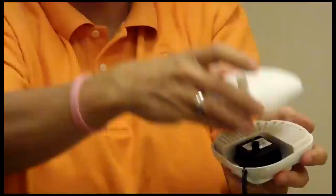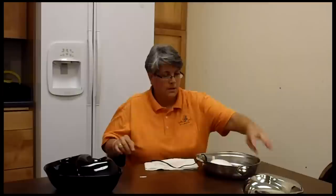We also need to put the filter in — filter goes in first. Then the pump housing cover goes on top. Once you have everything back into the pump housing, you can thread the cord through the slot. Go ahead and place your pump housing right into the fountain basin.